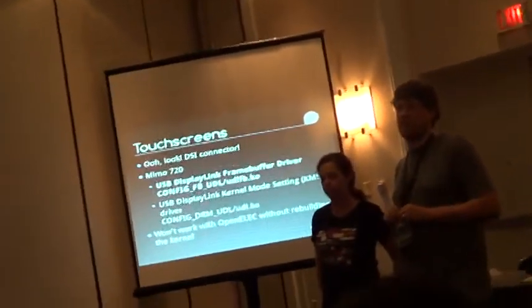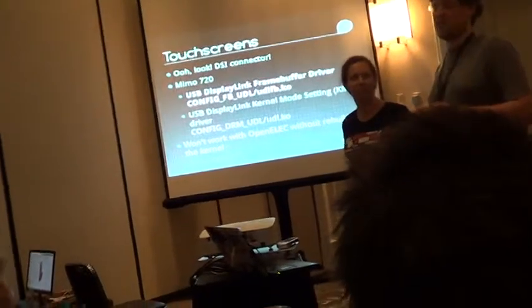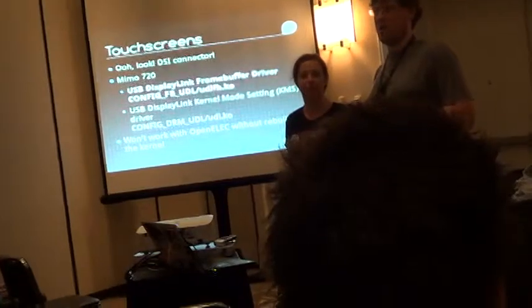The other big problem is that the Pi does hardware accelerated video out the ports that it has in hardware, but this doesn't magically pass over to a DisplayLink device. So the DisplayLink device will run entirely unaccelerated. So it is all the speed and technology that you remember from the 2D card that came in your machine in 1999 on your DisplayLink passing across the USB 2 bus. It is not fast. It is not efficient. You will go, ah, this thing is hideous. So no HD video. Absolutely not.